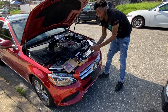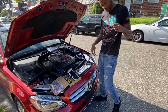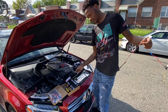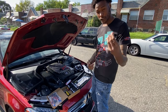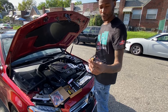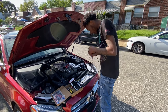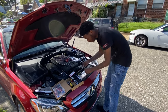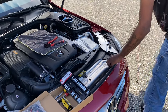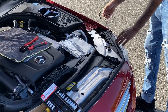Now you've got your wire harness — put that up. This is really important: you have to connect this side here to the wire harness. The fuse tap is very important because the red wire is going to be our wire that goes to the fuse box. We're going to use a fuse tap with a 5 amp fuse on top and a 15 amp fuse at the bottom. We're going to wire it right next to our headlights.